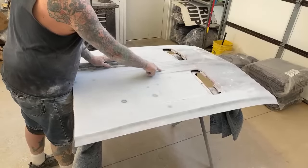We took our DA sander and went ahead and busted that glaze down. Do you see how I did that? Now we can go ahead and finish it by hand. Again, I actually recommend doing it with just a hand sander - but if you want to speed things up, you can do it just like I did. We're almost done with our lesson here. You can see that the bondo adhered to the primer and it did not peel off - it's on there strong and secure. Now we will hand sand this.